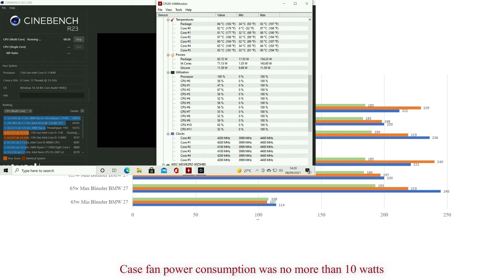On the under 25 watt setting, some of the packages are not actually going down to under 25 watts - some are going to 30, 34, even up to the 40s or a bit more, then going down, but not reaching under 25. The Gigabyte one we set to 125 watts so it won't go above that, which is one reason why the wattage scores come out good. The ASUS one does go down to under 25.